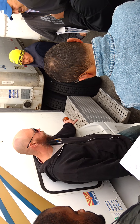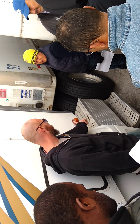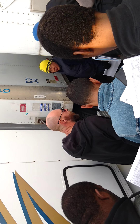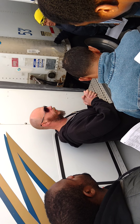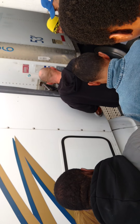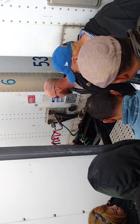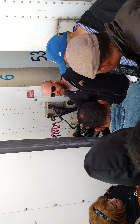Next is the outside mirror bracket — you want to make sure it's there, because if you don't have one, you can't see, you can't go to work. Make sure it's not broken. You want to make sure your door opens and closes. You can tell me about door hinges — every door has hinges. On this truck in particular, the gas tank is right here. The test asks for three things: the rubber seal in the cap, the tank has to be properly mounted to the truck with straps — none of that can be broken loose or missing — and the third thing is leaks underneath it. Next, right here, we have steps. If it's broken loose or missing, you won't be able to get into your truck.